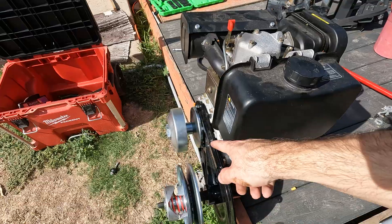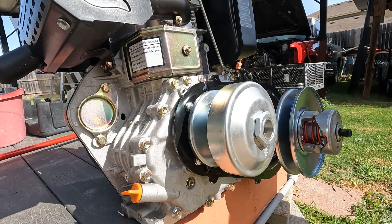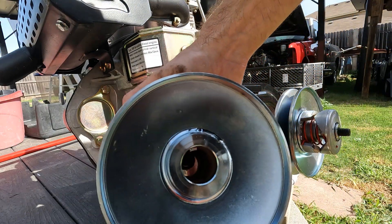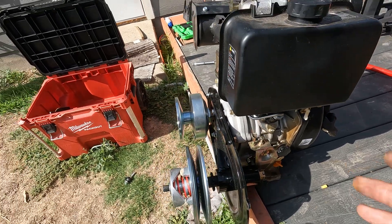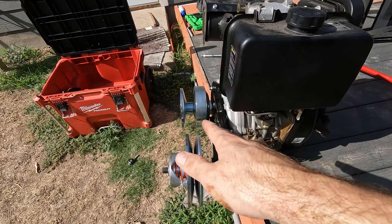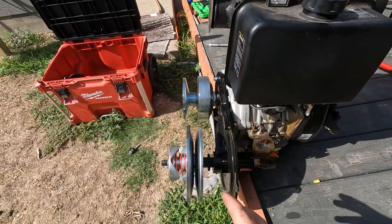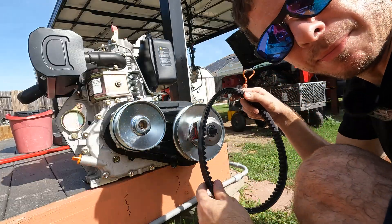Right off the bat putting it this way it's not even close to lining up, so let me flip the driver pulley around and see if that looks any better. It also has a keyway built into it for those who are curious. Look at that — perfect, the belt lines up perfect. I'm not actually sure which way it's supposed to go, but we're going to run it like this because it lines up. When we fire up the engine we'll rev it up and let it go through its RPM range just to see what the belt and pulleys do.